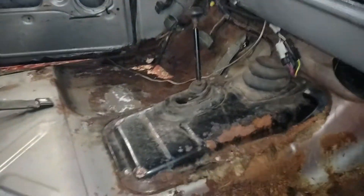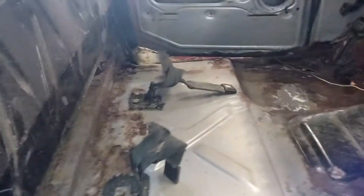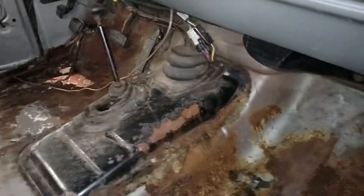So this is the project, and I probably won't show you much until maybe after I get it all cut out and replace what I'm going to replace. A lot of this — even though it's rusty — is still pretty solid, so I'm just going to clean it up and prime it with some rust preventative and patch over the top. I'll cut back here just to get all the weak stuff out. I might have to totally abandon the project halfway through, who knows — something else happens and then it's gonna sit for another who knows how many years.